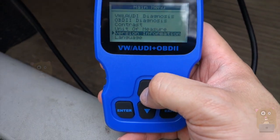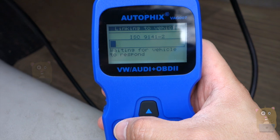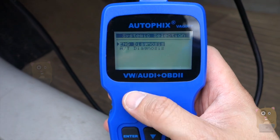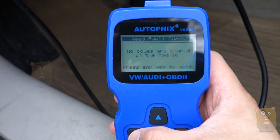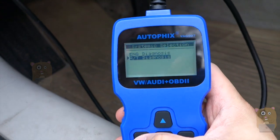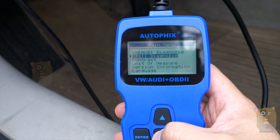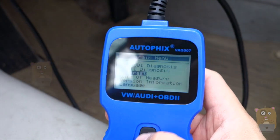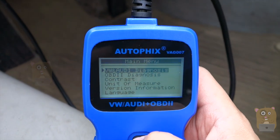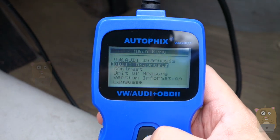Now back to this unit. Let me go to OBD-II Diagnostics and enter. I can check the engine diagnostics for any fault codes — none here, so I don't need to erase any codes. I can read the VIN protocols, read AT diagnostics, and I can also adjust the contrast. The LCD display is backlit. I can change the unit measure between metric and English. And here are the Volkswagen and Audi diagnostic codes — it supports all the main ones plus additional ones for those German vehicles.